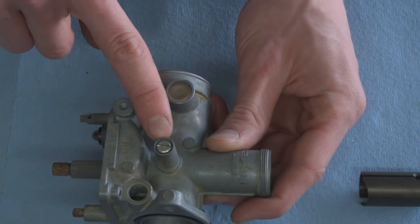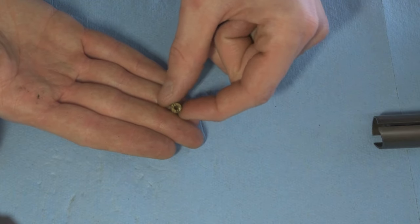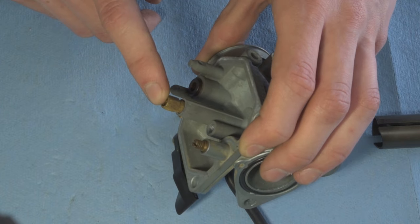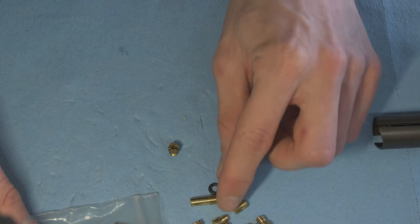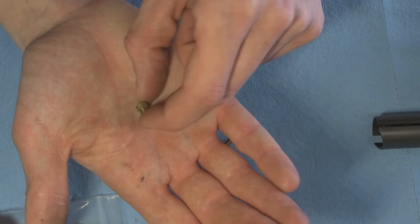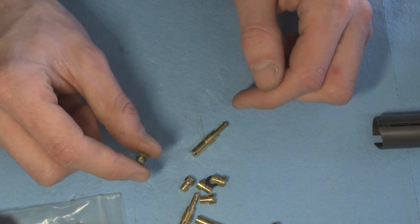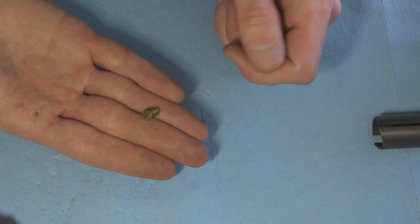On the side of the carburetor we have the idle screw, which changes our idle. Now the main jet — it's very tiny but very important. The main jet provides fuel at 80% to wide open throttle. Fuel flows up through the needle jet into the throat of the carburetor. When changes in air density are significant, the main jet needs to be replaced. Jets have tiny numbers on the side indicating how much fuel flows through — higher number means more fuel. If your bike runs lean, go up in jet size; if it runs rich, downsize. Throttle response issues at wide open throttle likely point to the main jet.